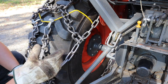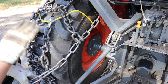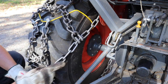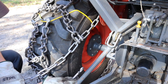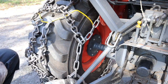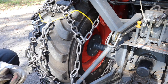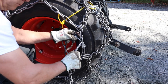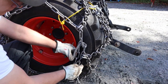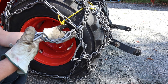Now that we have the chains on, the instructions on the Canadian Chains website say you always do the inside fastener first, then the outside, then you put your shackles in and tie them in just below this big double chain here. If I'm doing it right, looks like we have a little bit of extra chain hanging off — and yep, got extra chain on this side too.